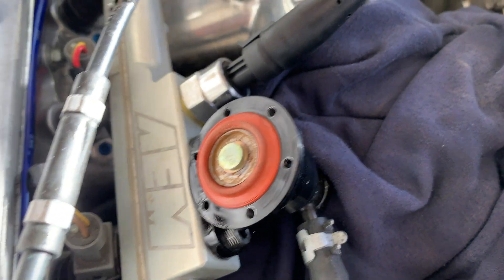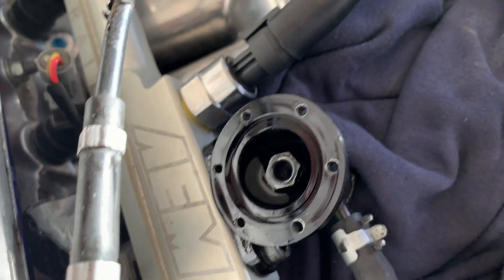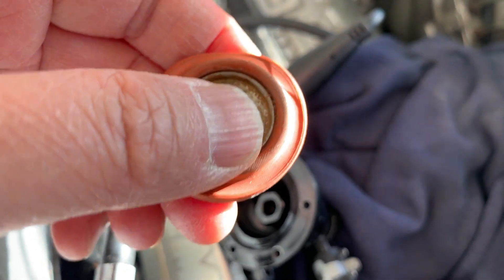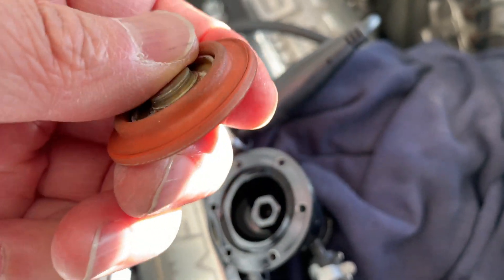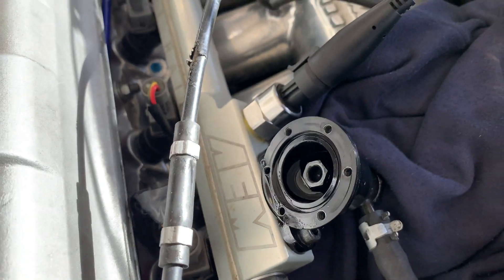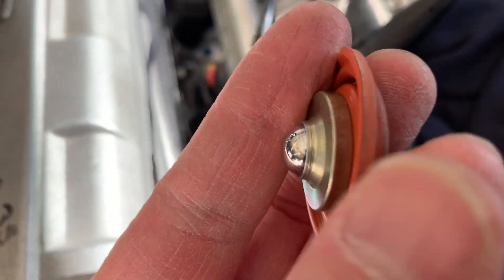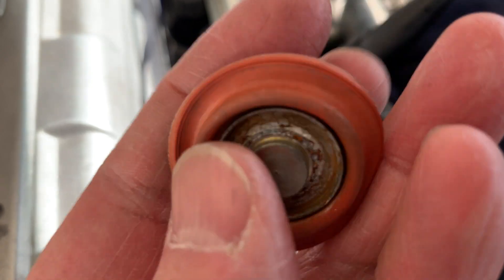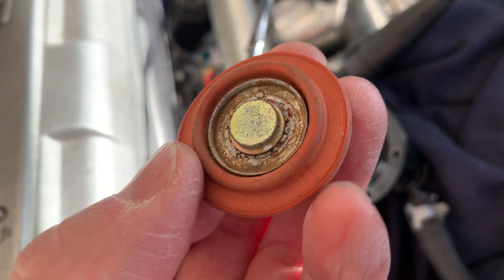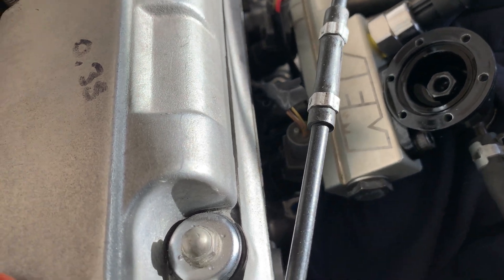This is the diaphragm that is prone to failure. I've had this open and closed probably 40 times just messing with the orifice under here and tuning. I've had pressure regulator diaphragms fail before — really, really bad in my old Holley. That's why I switched to the AEM, because these diaphragms are easily purchased and replaced. No local stock though, I have to order online. You can see it is drying out, so it's getting replaced with this new one.